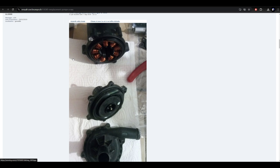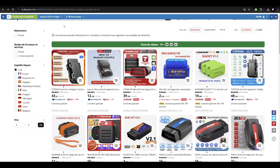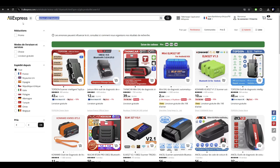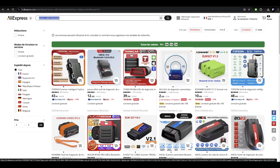So first we're going to check why you have this light on — you're going to need a dongle. I recommend going on AliExpress or Amazon and searching for an OBD2 Bluetooth device. A basic 2-euro model is fine. You can use it with your smartphone and apps like Torque, and you should be able to read the full fault codes on your car and any other car.